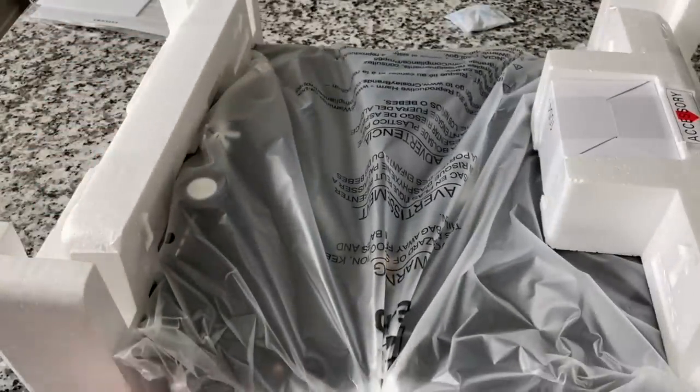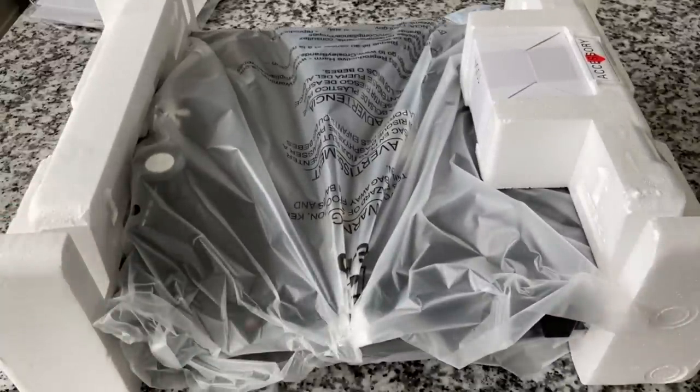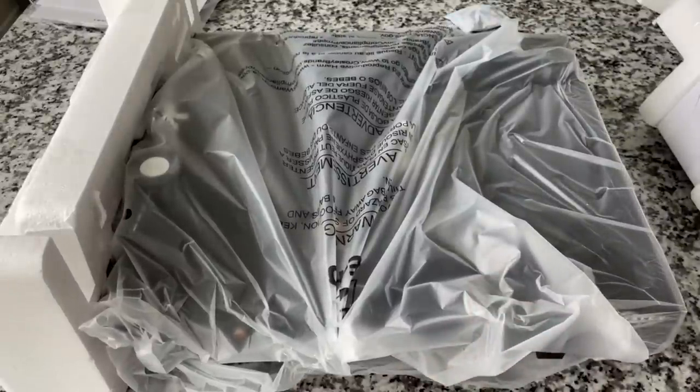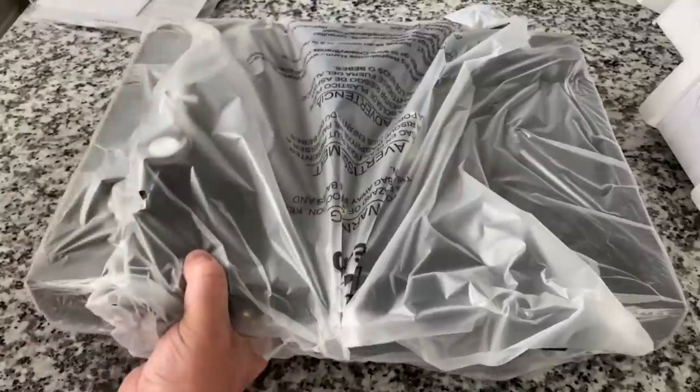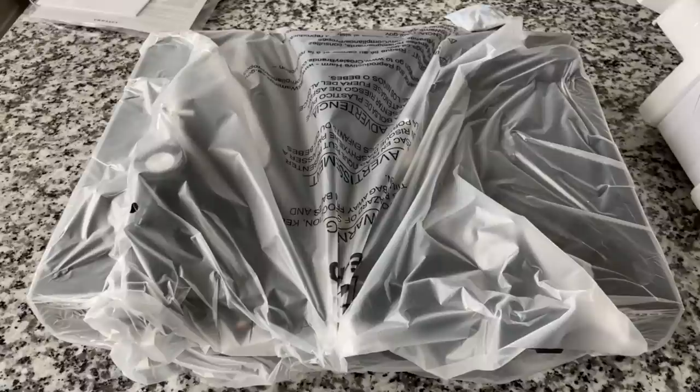Hold on to that. We can flip this back over again. Now, it isn't super heavy because Crosley, in their partnership with the companies that they work with to help build these things, have made a decision not to weight the product. Audio-Technica has chosen to weight theirs, so it'll feel heavier out of the box. And that is because they literally put a weight inside, just like Beats headphones are famous for their metal weights. And it's not just like, oh, it's heavier, it's higher quality. But the thought process is, you add weights, then there's stability and the resonance properties change. Crosley discovered that there's really not much benefit to doing that. So they left the weight out, which I think is perfectly fine. I haven't noticed a difference on the LP120 versus this based on the weight or lack thereof.